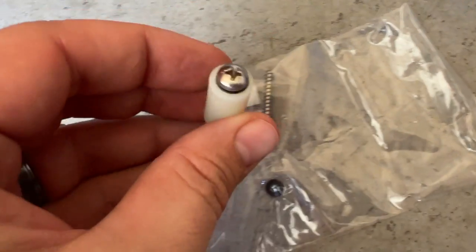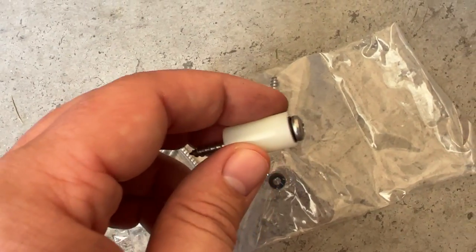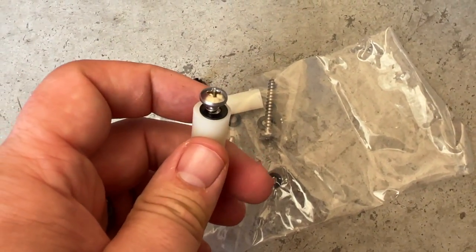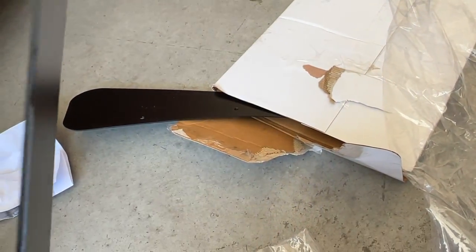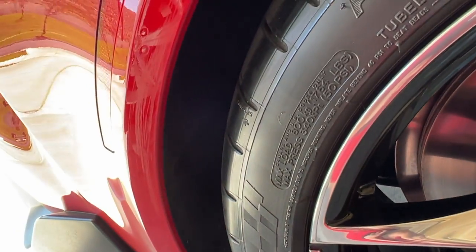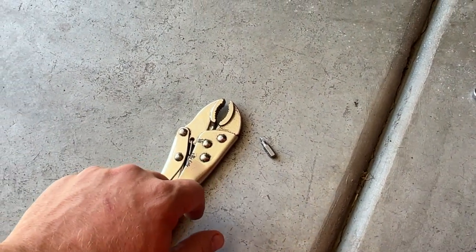Here's the hardware — that's how it's going to go. I recommend putting in the top one first to get it in place before doing the others. The spacer goes back behind the rock guard, and the washer goes underneath the screw. I'll show how I'm doing it — it's pretty straightforward. Getting the top one started first and seeing how much space I have to work with.